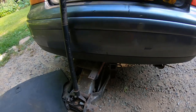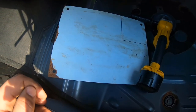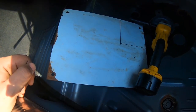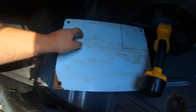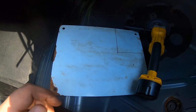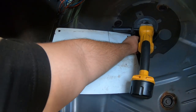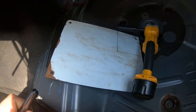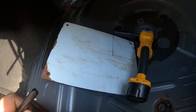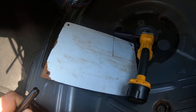You do have to drill into the trunk. I got this plate steel here because the trunk is thin sheet metal and I don't really trust the bolts just going into that. So I think I'm going to cut out a plate, drill the holes, and sandwich it to try and strengthen it up. You don't have to do that though — supposedly it's rated for 2,000 pounds towing and 200 pounds tongue weight just off the way it mounts, but I just like to be a little safer.